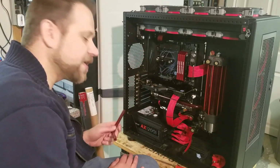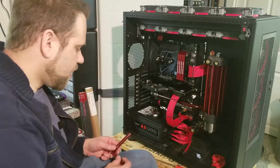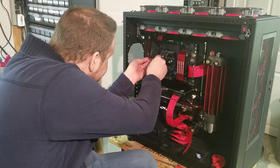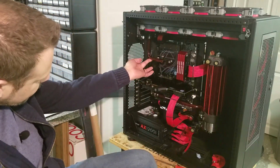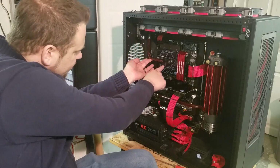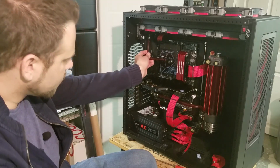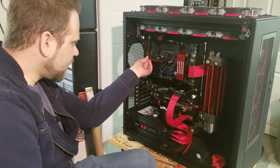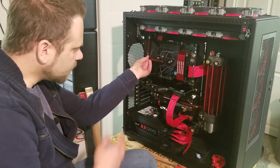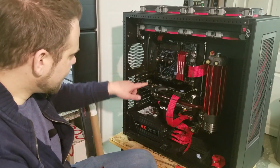The battery on my mic died, so I'm just going to voice over the rest of this one clip. Anyways, after successfully bending your tube, you're going to want to hold it in place and make sure that the angle of your bend is correct, and make sure the length of tube going from connector to connector is correct. Now we can see from this video that the length of tube going from the radiator down to that first bend is pretty much perfect, but from the bend to the monoblock is a little long and going to need to be trimmed down.